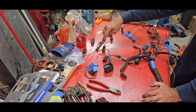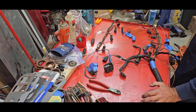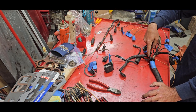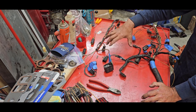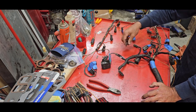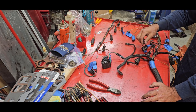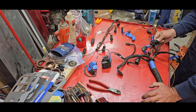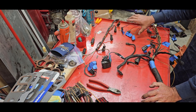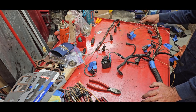While I'm here, I'm also going to move the gauge sender wire and extend it over to this side, and bring the ECT connector over to this side — covered in another video, had to do that because of the way the fuel rail was. Then fix the splice that's there. The AC connector — not doing anything there. Capacitor — not doing anything there. Distributor — not doing anything there. The EVAP — getting rid of that. Throttle position sensor stays, idle air control stays, and all the air injection stuff is gone.